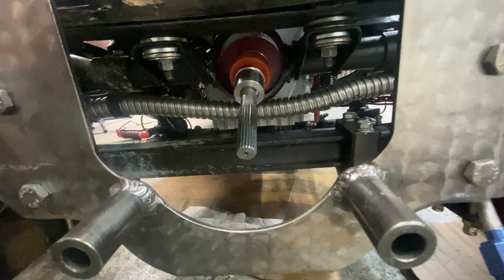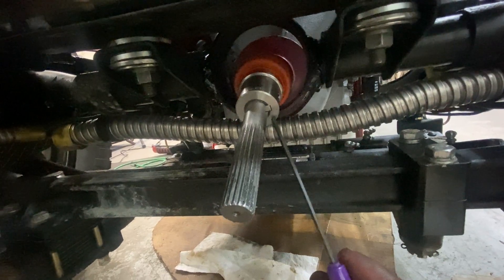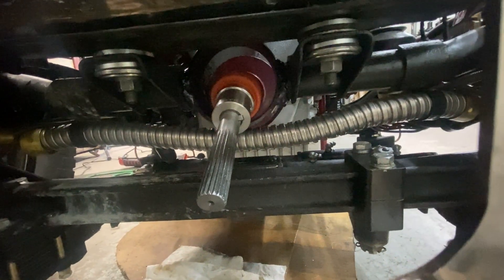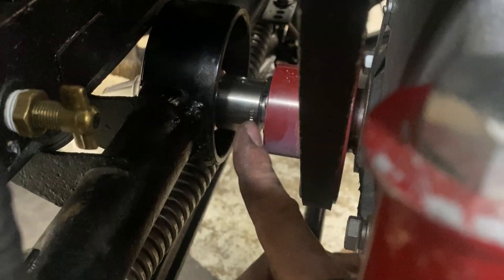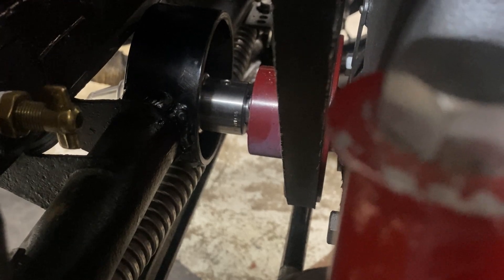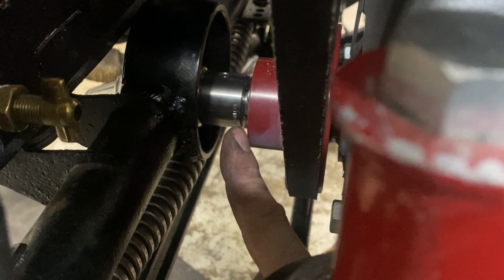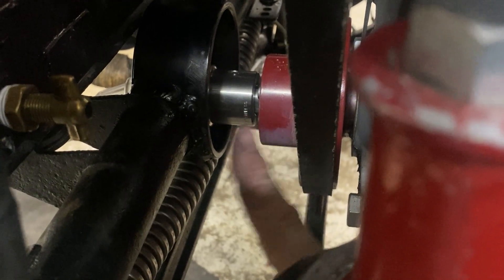I calculated how long this shaft has to be in order to get enough purchase in the keyway and enough splines on the outside to engage. Yesterday, Carl Klontz helped me mill keyways — there's the keyway there, which provides engagement. Then it's the same thing on the other side, and there's a keyless shaft bushing that goes into the crank pulley. That keyless shaft bushing is basically a wedge inside of a wedge. As you tighten the little bolts, those wedges push against one another, tightening against the outside diameter that engages here and against the inside diameter that engages the shaft. I set that up and torqued it correctly, then put on the universal joint, building that shaft toward the front of the car.